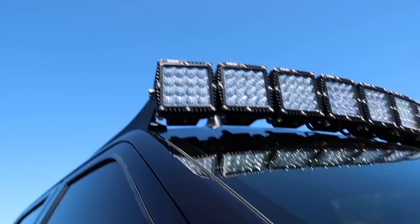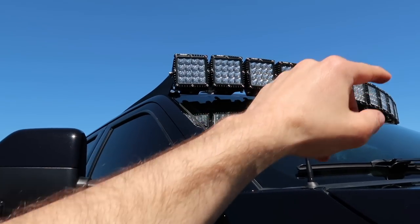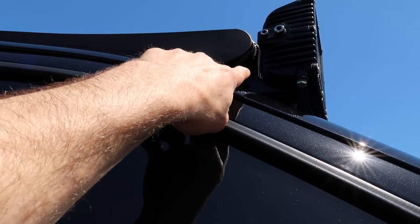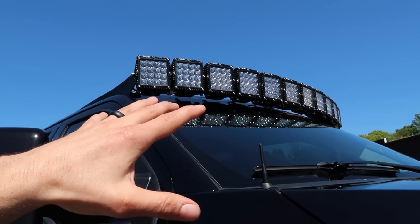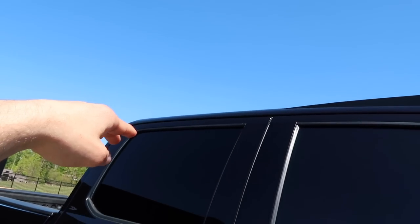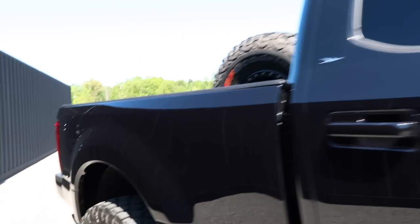The light bar my dad and I created — we did the idea in the shop and then all of us attacked it. Jaeger welded everything together and did a very good job. Each one of these lights — all Rigid Industries — starts as six pieces. I had to cut and fixture every single piece of this light bar, radius a bar that matched exactly on the windshield, then attach a bracket and bring all the weight across the cab because that is a heavy light bar.